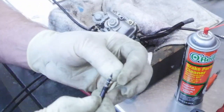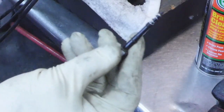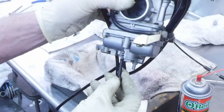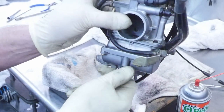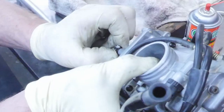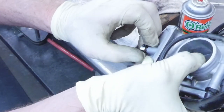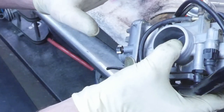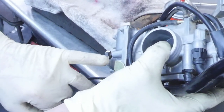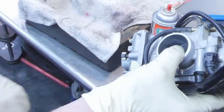It should snap back beautifully. We're going to install a new O-ring on the top, finish this up, and then test it before we reinstall it — making sure it doesn't leak and it's working good. Spring, washer — it's a special miniature washer, can't use just any one, it's a little tiny one for that size only. The slow jet ring sits on there and I like to put them up from the bottom so nothing falls off. Bottom it out lightly, then turn it out about two to three turns. I'm going to go to three turns out from bottom.